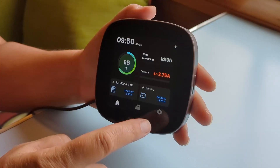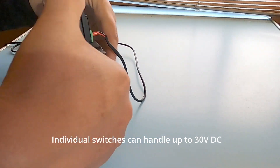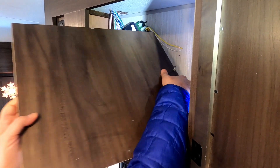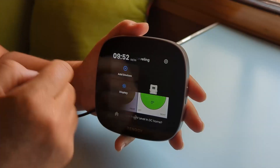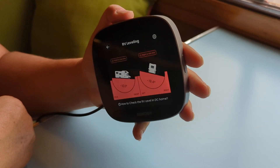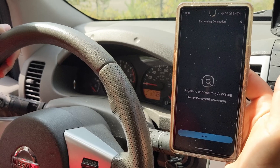If you're deciding between the M1 and the Core, the Core is smaller with a stylish design, easier to install, and more user-friendly when adding and programming devices. The smaller design eliminates physical switches and relays, instead offering Zigbee smart home automation accessories that work wirelessly — reducing the wiring headache of pulling wires from various appliances to the M1. The Core also has the new RV leveling feature, which the M1 does not. It's a nice upgrade for a single-vehicle RV like a van, motorhome, or truck camper, but if you tow a trailer, the Bluetooth signal is not powerful enough between truck and trailer.